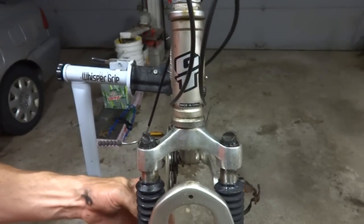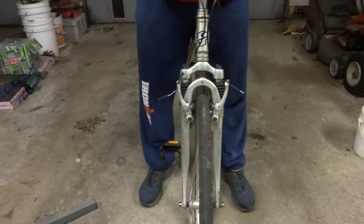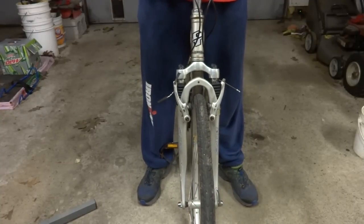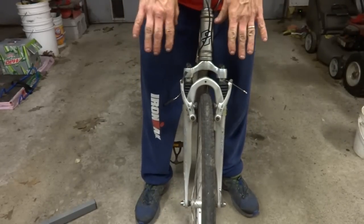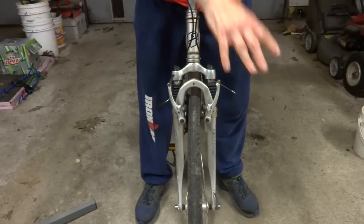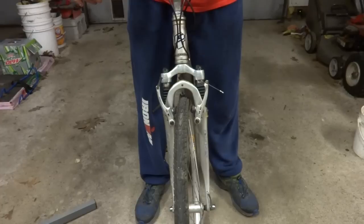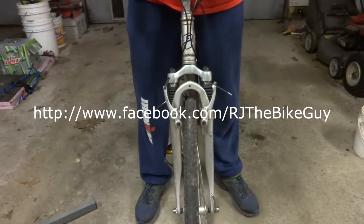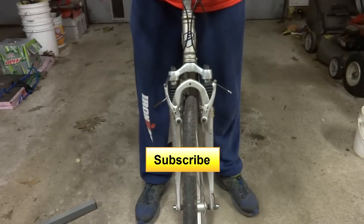I'll connect the boots down onto the little seals — they just snap into place. I got the shocks all put back together, except for the brake cable, which I'm going to redo separately along with all the cables. They move now — they're still kind of stiff, but before they didn't move at all. I think once the bike gets ridden a bit they'll loosen up as the grease gets worked around in there. I hope you liked the video and found it useful. Please click like and if you're not on my Facebook page look for RJ the Bike Guy. And if you're not subscribed to my YouTube channel, please subscribe. Thank you very much for watching.